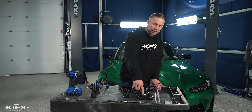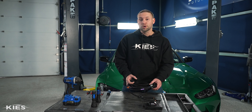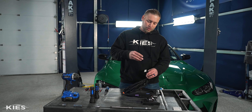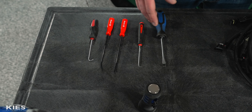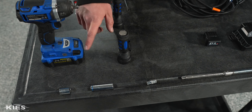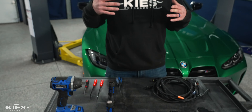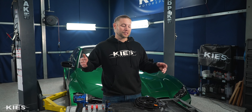For what we're going to be installing today, we have our Daylert Performance Module, our wire harness, and this little plug. This enables you to leave all your wiring in place, but if you need to go to the dealer or just want to run the car without a tune, all you do is plug this in where the tuner goes and it completely disables the tune and makes the car run on factory settings. As far as tools are concerned, you need a flathead, a couple pick tools, a good flashlight for tight areas, a couple sockets — we have a 10 mil, 13 mil, and 15 mil with extensions — and a power driver. We're going to pop the hood, pull off the brace, pull off the engine cover, and remove the intake on the driver's side. Then we have this nice plug-and-play harness — 100% reversible. We'll route the wires in a convenient location, plug in the tuner, and we're done.